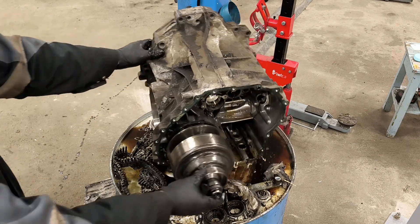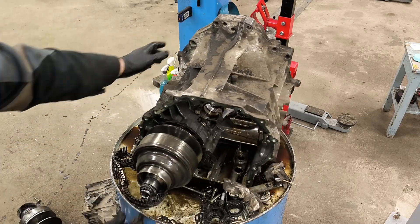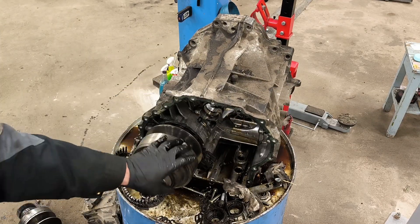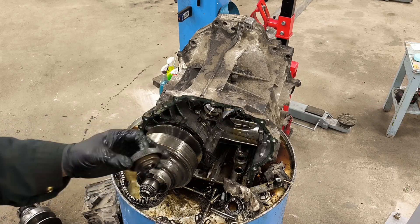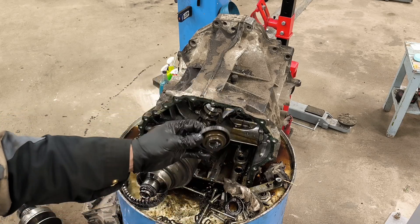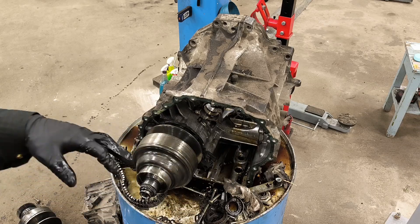This piece from the housing — and that's all I've done. It's actually simple. You can see through my video if you need to change, say, the back housing or something. When you remove all the bolts, before you pull it up, these two magnet rings for the sensors — speed sensors — you need to pull them out. There is one circlip and the housing comes out.